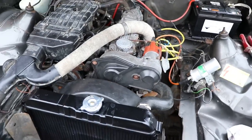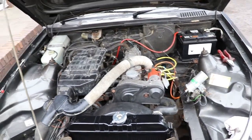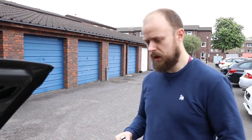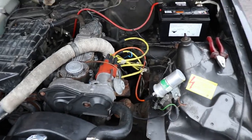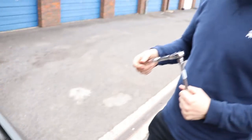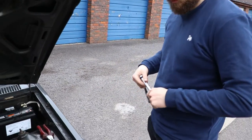The engine runs — everything's good, well, let's say everything's good. The carburetor cleaning has made a massive difference. We've adjusted the air-fuel mixture and that seems to be good. However, we now think we've got a misfire on one cylinder. We've had a play around with the HT leads and distributor but can't pin it down. Timing is a possibility, but we'll look into that and see where we get from there.